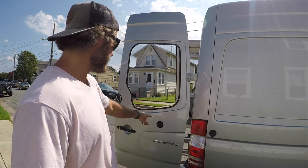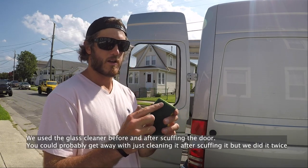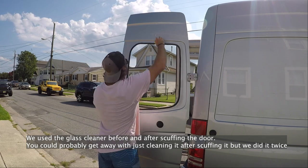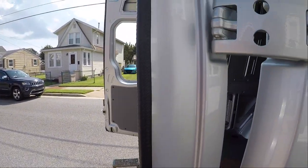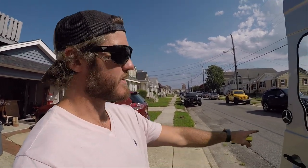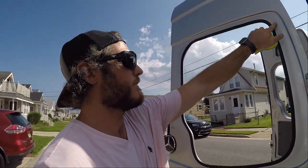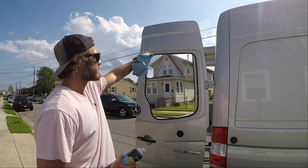For the window prep, Taylor already cleaned it with glass cleaner. I'm going to take the back of a sponge — the rough screen part — and scuff it up so the primer sticks really well. You can see that scuffed line right there. Same thing here — see the line where it's scuffed. Next step is to get an alcohol pad or glass cleaner and go over it one more time to make sure all the dust is off, then we'll apply the primer.